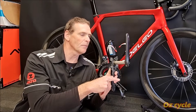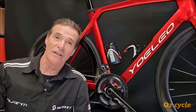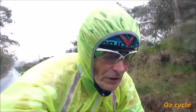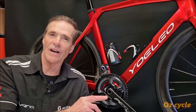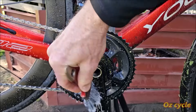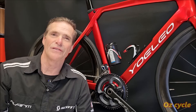After about 15 rides with this power meter on the bike — and it's winter, so every second ride is wet — it's working fine. Waterproof, dustproof, and mudproof. After every ride I clean the bike with soapy water and wash it off, and it still works fine. Comparing a spider-based power meter to pedal-based: at least at the end of winter or wet months, you don't have to go pulling your pedals apart to service them if water gets past the seals into the bearings. And because you're using your own pedals, you don't have to worry about cleat adjustment, changing shoes, or Q factor differences.